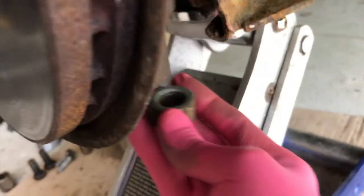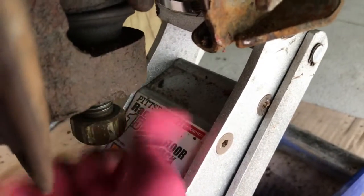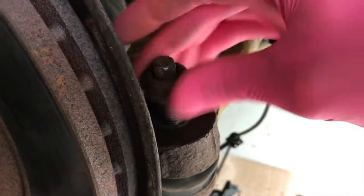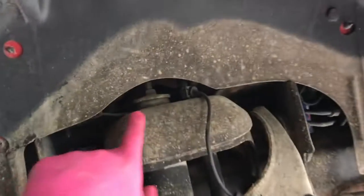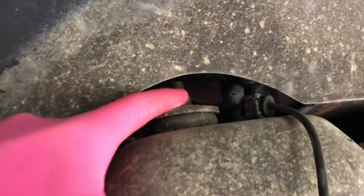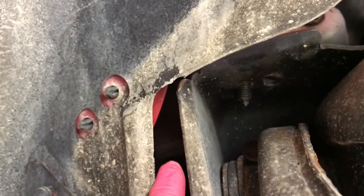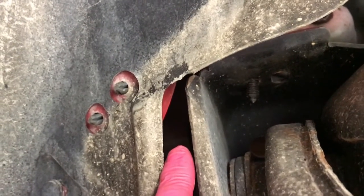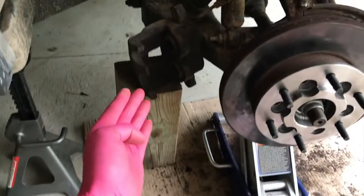Next, down below, the bolt joint. Don't forget this nut here. Go ahead and secure that. And once that's secured, don't forget the additional upper bolt here. Speed sensor is all secured, and loop it around that little bolt and nut there. And make sure it is aligned properly, and make sure you hear that clicking sound when you connect the electrical connection point. From here, we'll grab the caliper brace and secure that, as well as the caliper itself.